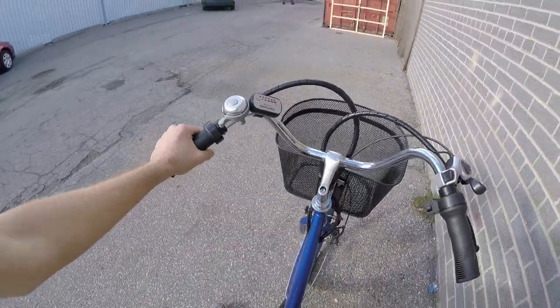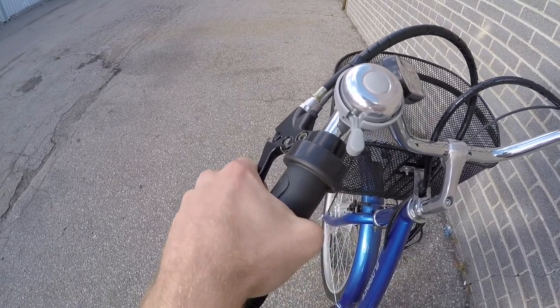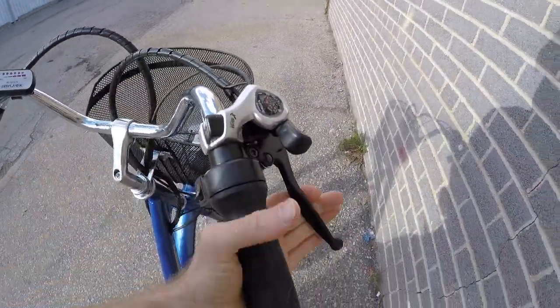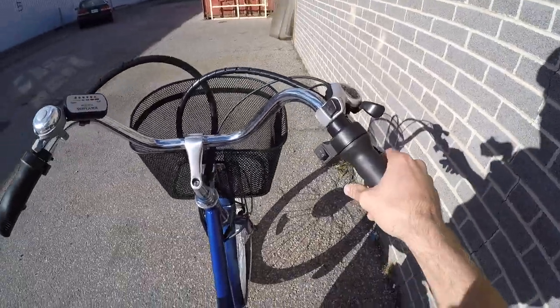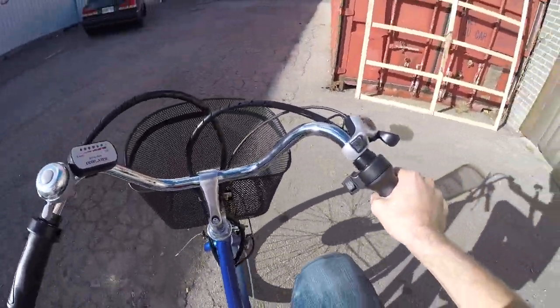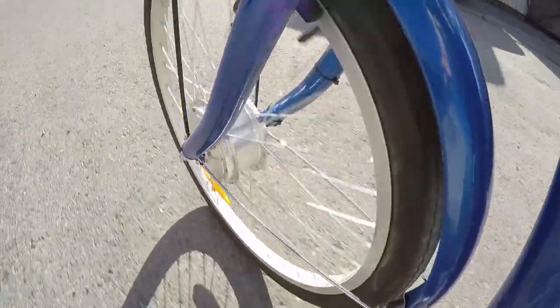Overall, I'd like to see this be a little bit cheaper, but there aren't really very many to choose from, and given the weight and some of the extras, I think that's what they have to charge. Here's the brake lever I was talking about on the left — it's mechanical and I feel myself really having to squeeze to activate those drum brakes in the rear. It does have the motor inhibitor on both levers, which is good. On the right side it's so much easier — I can even squeeze it with one finger. That's doing the V-brakes. We've got these semi-ergonomic grips and a twist throttle, so be careful: if you twist it the bike could take off on you immediately. Pedal assist is the same way — as soon as you start pedaling the motor kicks in, but it's relatively smooth.